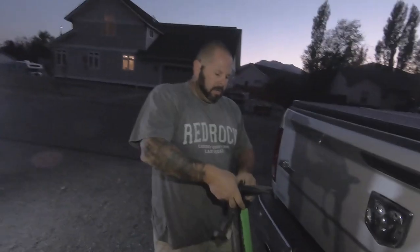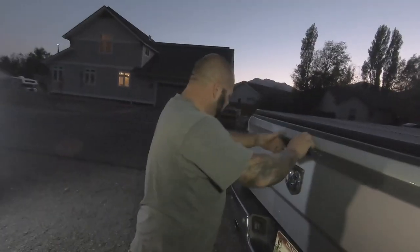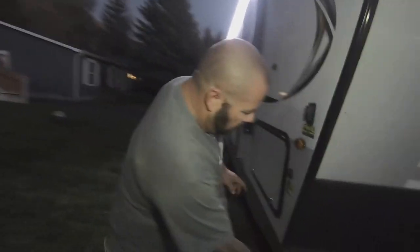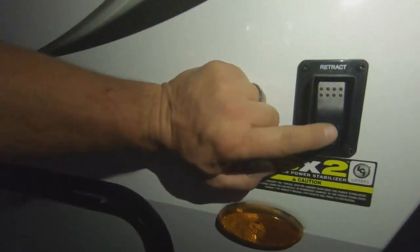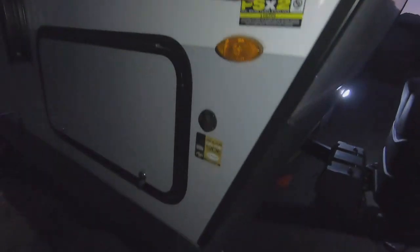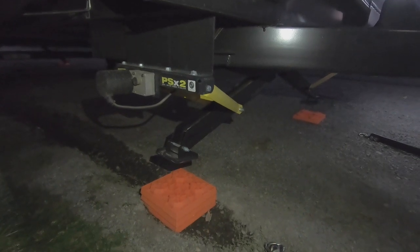Now that we've got the air in the airbags, we're going to back the truck up — actually, wait, we're going to go over here first. We're going to lift up our stabilization bars. On here you can see I've got a retract and extend button, so we're going to retract this up. As you can see they're now going up, and we just hold that button until they're all the way up — both of them.